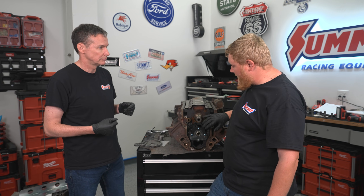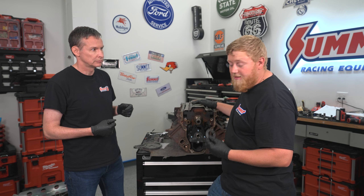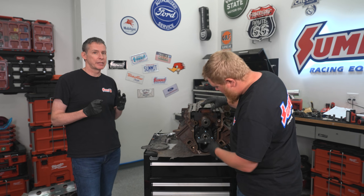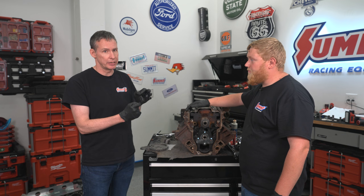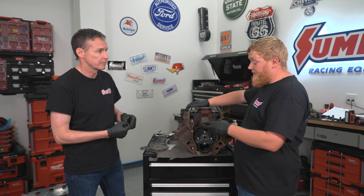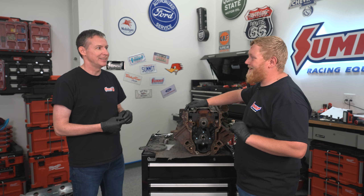Before we throw all the timing stuff on, we're going to put our bottom timing gear and oil pump drive on. It's one of our Summit Racing timing sets. We are going to set this up at zero. Pro-LS cams and many cams these days have the advance ground into the cam - when you look at your cam card, it's likely ground in, meaning you're still going to go dot to dot on the timing chain set. If you've got an adjustable set like this, make sure you're going dot to dot, knowing the cam already has the advance ground in. If you didn't and added four degrees advanced on top, you'd have seven degrees total - a little much for this application.